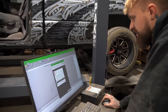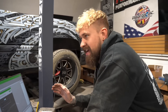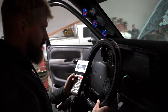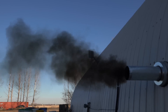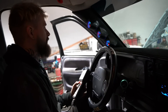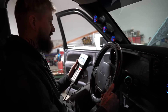We're not going to use any load on the dyno. We didn't have any load when we dynoed this thing at first because these rollers are heavy enough that it could spool the turbo. But I think we're probably going to have to add some load. We'll do a few runs and see how it is. We had 255 horsepower as the max before — I'm guessing we're going to be down to like 200 horsepower until we add more fuel. The boost is weird: it barely has any boost and then all of a sudden it starts giving some, but we only hit about 15 PSI. Let's go see what we got.